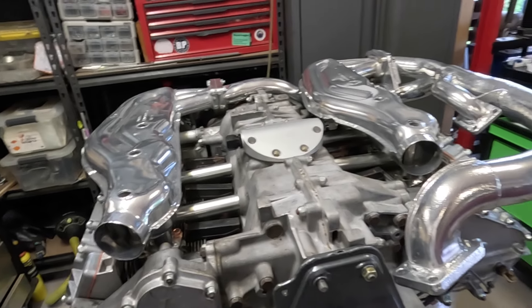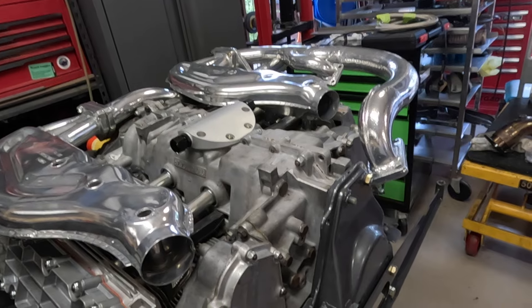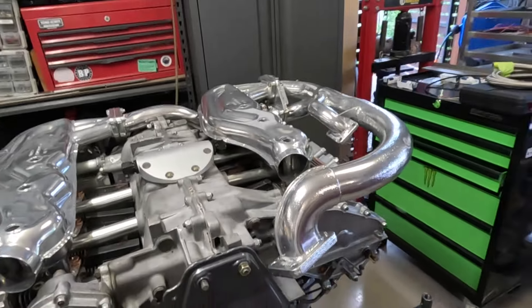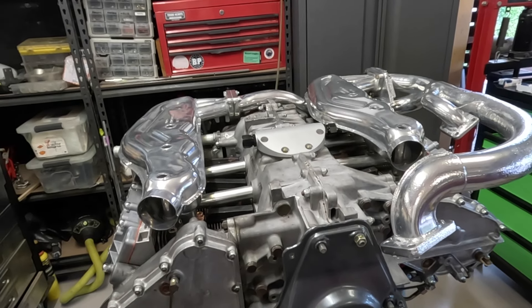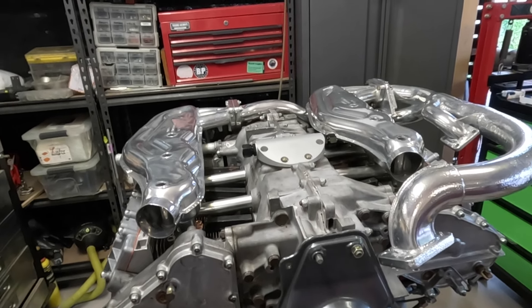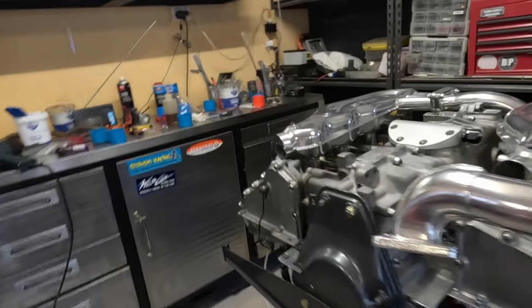I am still planning to run gravity feed for the oil drain from the turbo and everyone's going to say I'm going to have all sorts of problems - yeah maybe. I probably should have just gone with an oil pump from the get-go but I guess I'm learning. I'm not saying I'm an expert - building an engine I can do, but this is the first time I've played with a turbo. From what I understand, the original 930s had journal bearing turbos - plain bearing - and they have a lot more oil going through them. That's why they used to run a standard oil scavenge pump that would run off the camshaft on the left hand side of the motor, similar to how a power steering pump runs off the back of a 964 or 993.